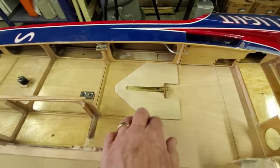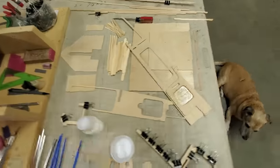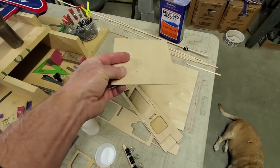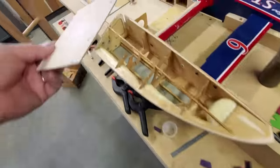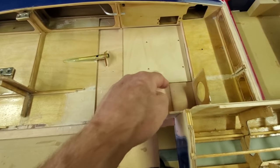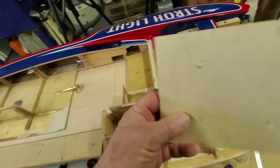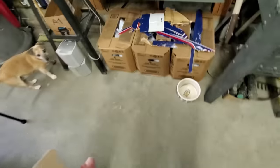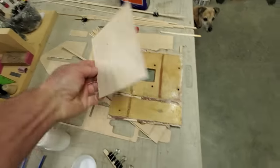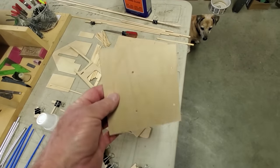I thought the reinforcement all the way on the stuffing tube here would be a nice idea. The forward floor section is ready to go. The cutout of the floor gets doubled - I cut another 1.5 millimeter piece that lays in and fits perfectamundo and is captured in here. It's 5 and 5 eighths by 5 and 5 eighths - a nice square piece. I had the original floor that got blasted out, so I just took and laid it on there and it told me where the holes needed to go. Theoretically the motor will be just exactly back where it was.